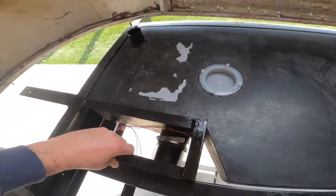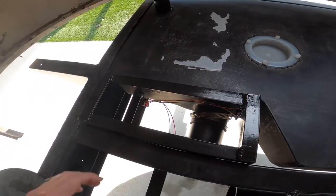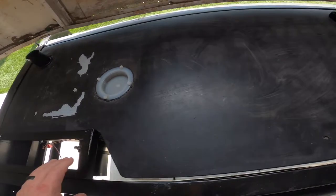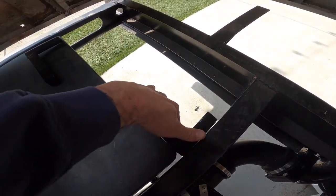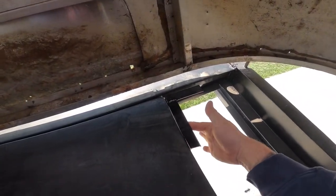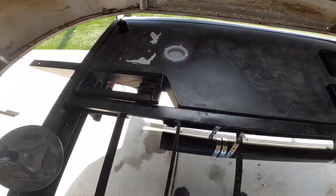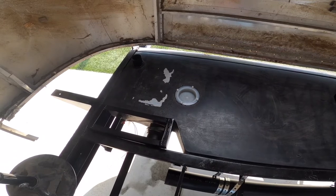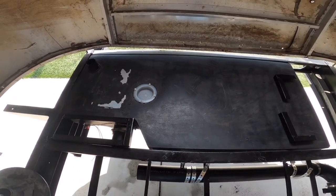We will then grab this bracket, put that into place, bolts here to this cross section, bolts here to this cross section. We'll then grab this one, it bolts to this cross section here, as well as grabbing this and bolting it to this back cross section. From there, we'll re-hook up this line, fill it up, make sure that everything is watertight sealed, and we will call this black tank officially complete.